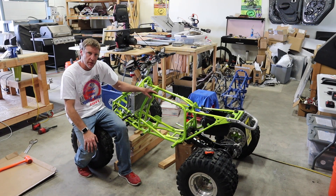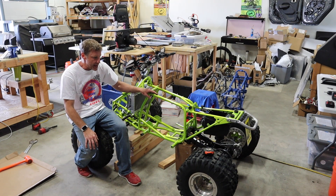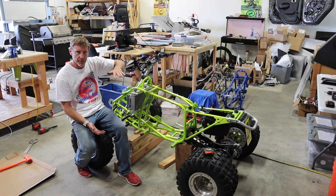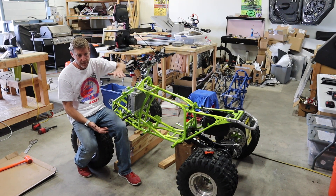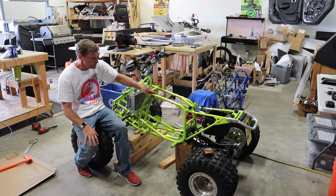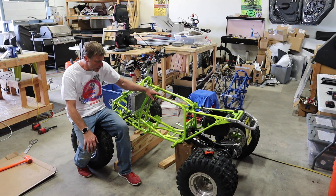Because this is a no-link, the numbers don't work on the rear. The no-link shock is so plush that it needs to be longer, because just from the weight of the motor and all the other stuff itself, it's going to sag and come down, and then you've got your own sag when you sit on it. This will work for a 250R standard linkage setup. It should work for a 450R, YFZ, whichever — the numbers may be a little different.